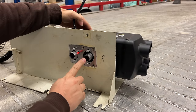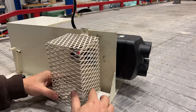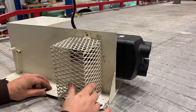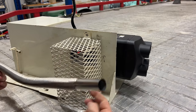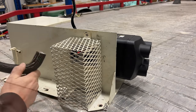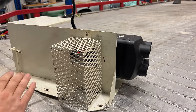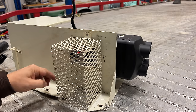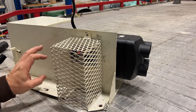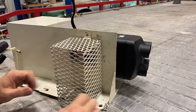On the bottom side: this is the exhaust, this is the intake, and this is the fuel line. I'm going to reuse the exhaust cage — it's been cut so the new inlet can come out there. This flexible exhaust line will run out and then out the wall, all within the cage so you can't burn yourself. The intake hose will go back up into the airbox the original one used. As for the fuel line, I'll have it come out of the cage somewhere — not sure exactly where I want to mount the fuel pump yet.